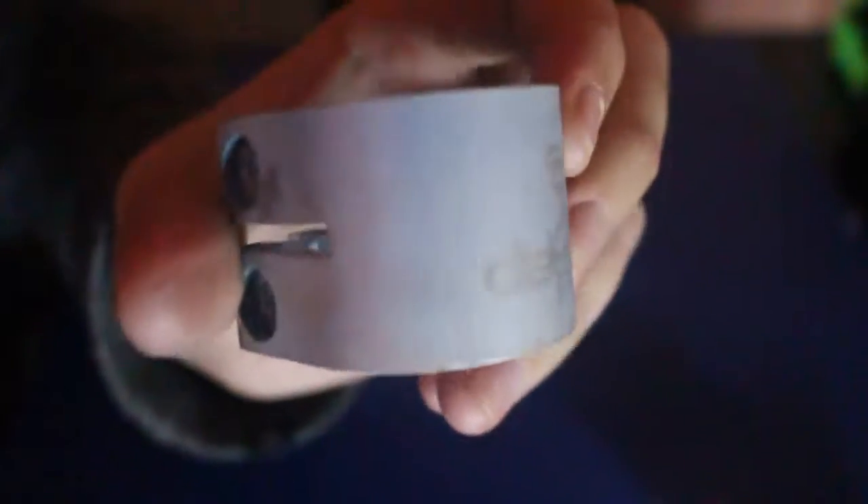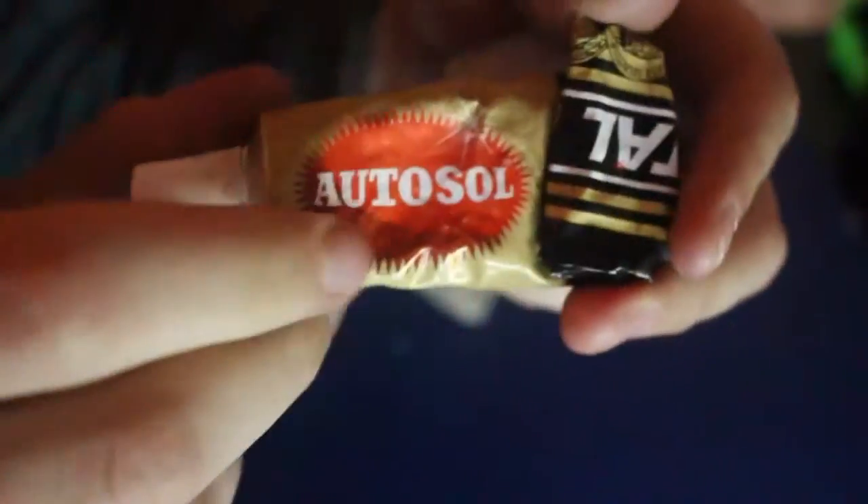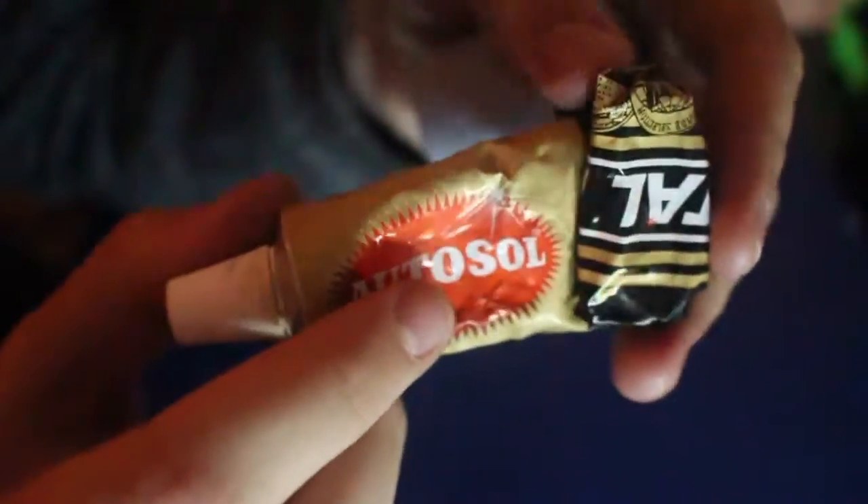The final step to fully rawing an item on the scooter. You might notice that this still has like a whitish powder on it - that is actually in the metal, and when you polish it that will get it out. What I'm using is AutoSol Metal Polish. It comes in tubes and tubs, I'm just using the tube. You want to get some cheesecloth - it's a rough kind of cloth that's good for polishing stuff.